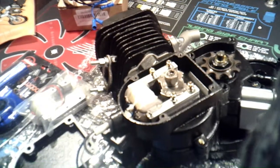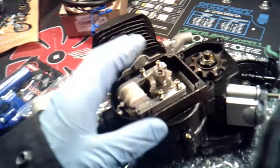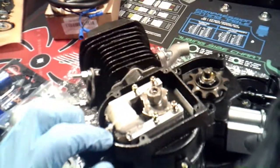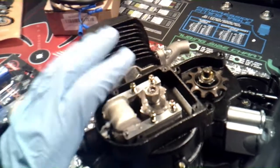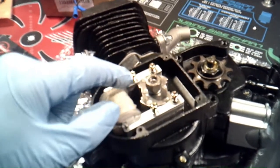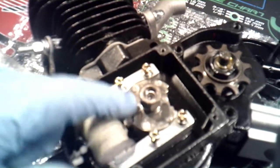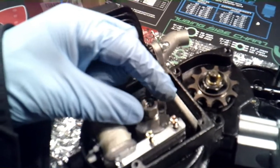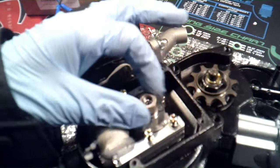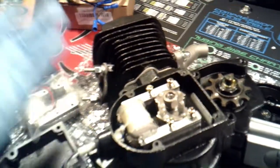You guys ever buy these kits — I cannot stress the importance of having to tear down the motor to put it back together the right way. I'll give you an example: I was just unscrewing a screw and I happened to look at this nut — the nut that goes over the actual spinning magnet or armature inside the magneto. Look how loose that bolt is — I can spin it with my pinky finger. It wasn't even tightened.